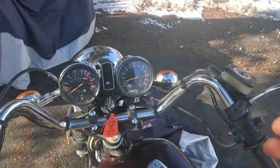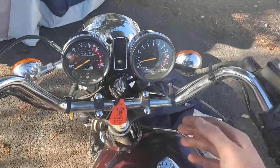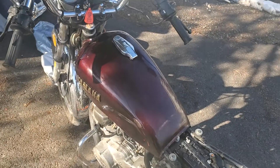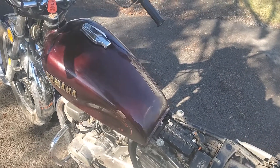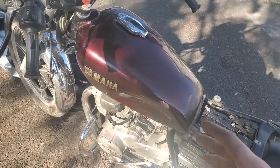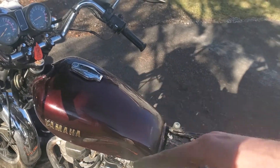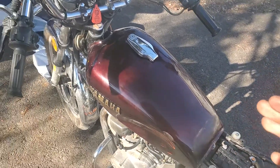If you have the choke out, you start it up and it freaking flies up — that's because, I mean it could be many issues, but for me it was because the carb slide, one of the carb slides resisted coming up and resisted going down. And I think maybe some jets were plugged.